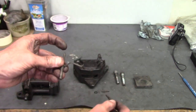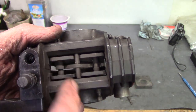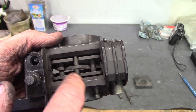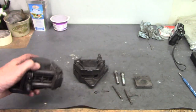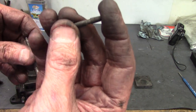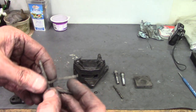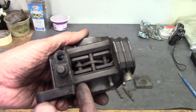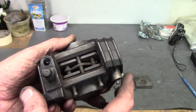There's also a center pin, but it's not mounted into the caliper — it just sits on top of the brake pads in a little notch, captive in a groove in that center pin. There's a little groove in the middle and it fits like that. Once you pull the pins out and remove the clip, you can drop the pads out and replace them. Very easy to do.